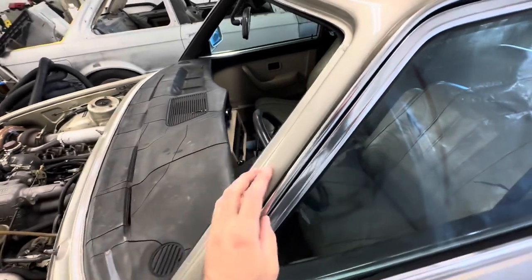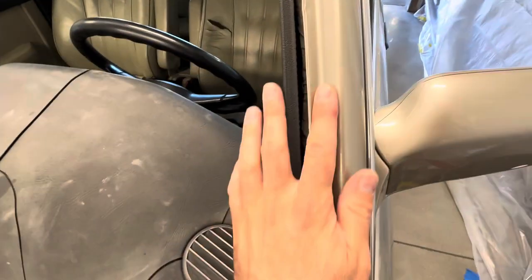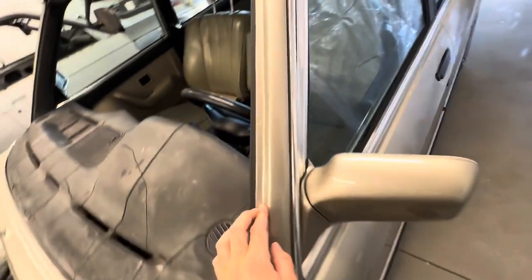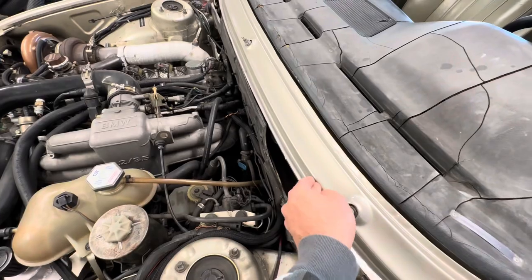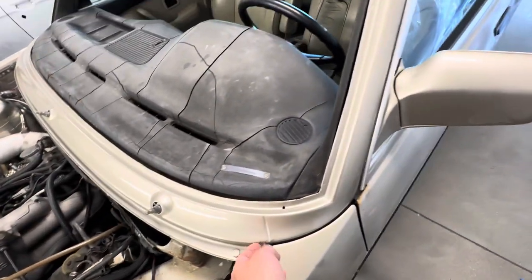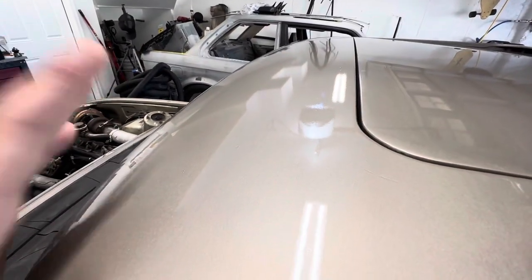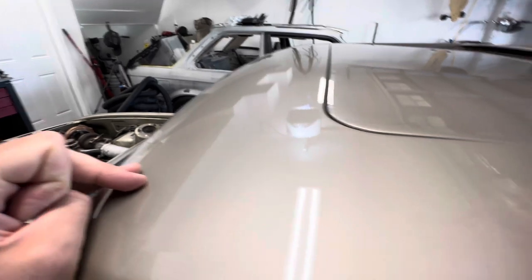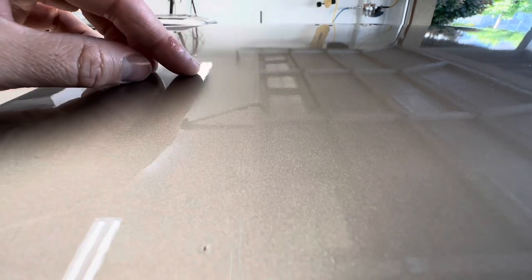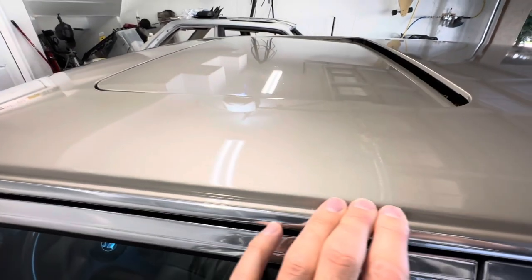I'm not a professional, but I like it to be pretty hardened up before I mess with it. Anyway, this Nason — in spots where it's dry — it really got grainy and gritty. My overall thought for anyone looking to use it: spray it heavy and I think it'll wet out. I'm going to do another application on a different panel — the side of the car — shortly.